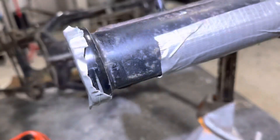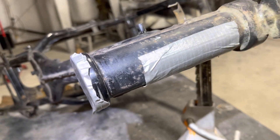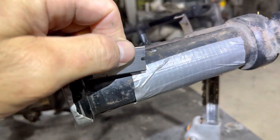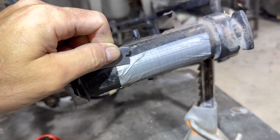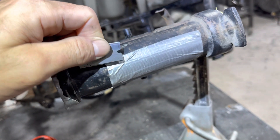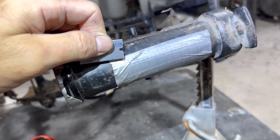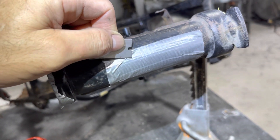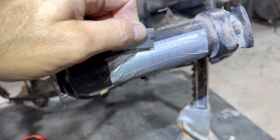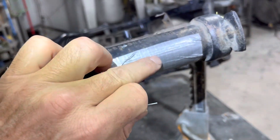When the person addresses it after blasting, right along the tip of the knife or the razor blade here is where they will conduct hand sanding operations, because there will still be some black paint close to the plate. That'll have to be hand sanded, and then they'll re-tape the plate up and prime it.